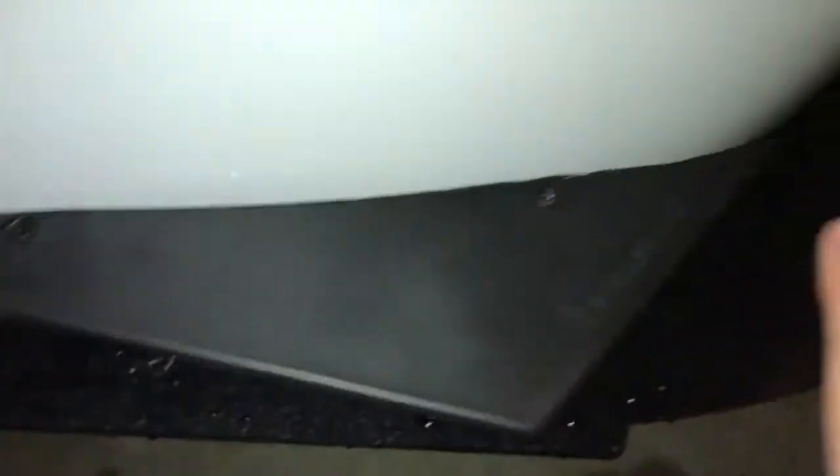With the bracket piece attached — which is just a little right angle piece with a hole on both sides — you drill that in with the bracket attached. Then you pop a screw through the canard and through the little metal bracket, resting it on both points. I used some thread lock to help hold it, then thread the lock nut in, which has a washer attached. Do that for both sides and it's pretty much installed.